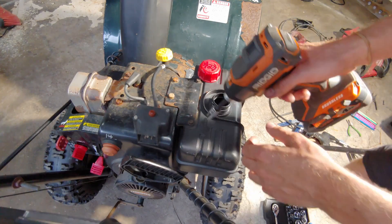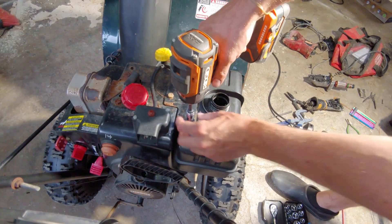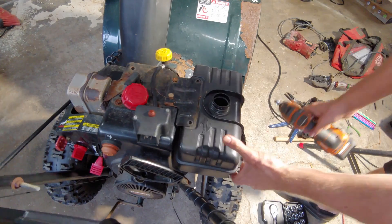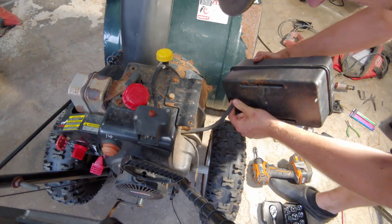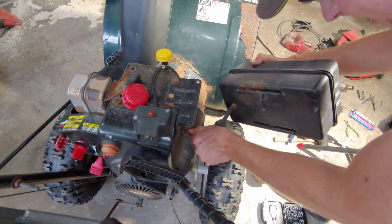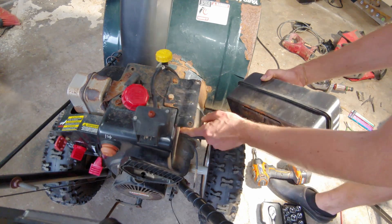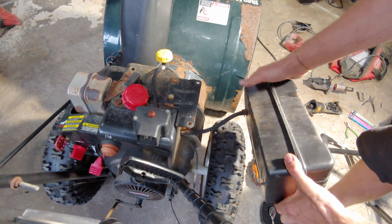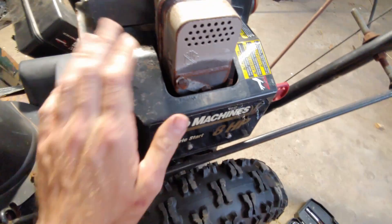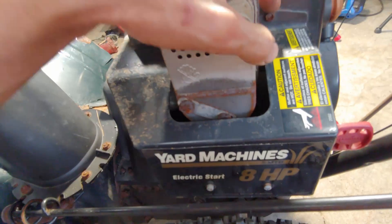Fuel tanks are always the easiest thing to remove. It's just these two bolts right here on most rigs like this. So boom and boom and slide down like so. The fuel line kind of runs through here underneath the starter through there. So let's see if I can get that line out so I can flush the whole thing out. I'm going to switch angles here and remove this cover that covers the carburetor. We've got small bolts over here, these two Phillips, and another one over here.